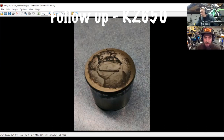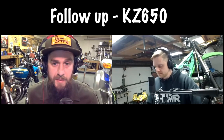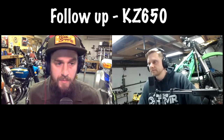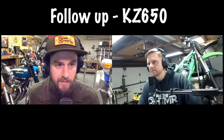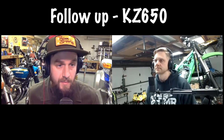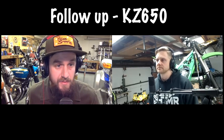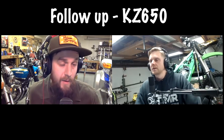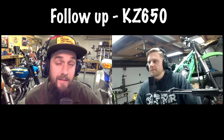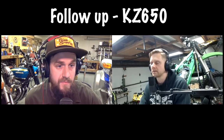I think he's on the right track. He needs to break down that head. You could look for oil seeping past the seal, with quite a bit of buildup on the back of the valve, because it's burning onto the back of it. Even then, he needs to clean the valves and seats up completely, then do a simple test pouring gas into the intake or exhaust track. Once it's all clean, I would maybe even go as far as lapping them if there is some crud on the seat. Given the age of the bike, it's very possible to have dried up valve stem seals.